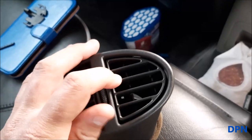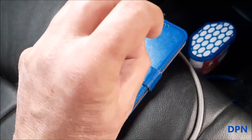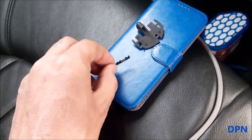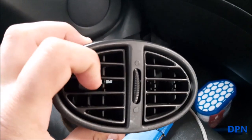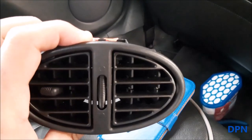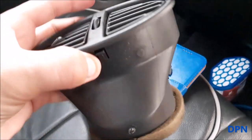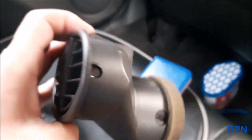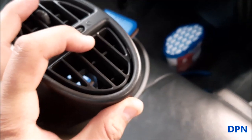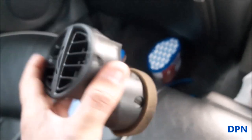While we were doing that, this piece completely fell out — it's the middle fin with the finger tab, and the little bar that links this fin to the other two directional fins still inside, so you can angle the airflow whichever way you like. There's also a little flap to turn the air on and off. To gain access there's a little dot on the vent — push something into it like a small screwdriver or metal trim tool and the inner grille will come out, giving you access to make the repair.